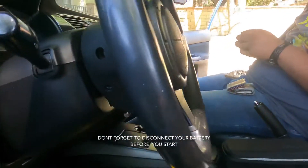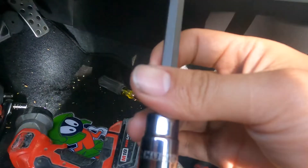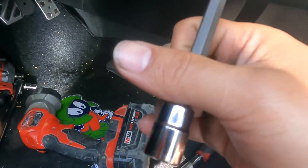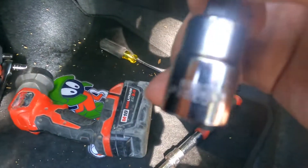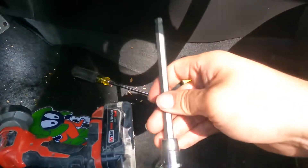To remove the steering wheel, you'll see this on both sides which looks like a torx — but you don't remove that. The one you actually have to remove is this one right here, which is an allen. I got this from Home Depot. It's an 8 millimeter.